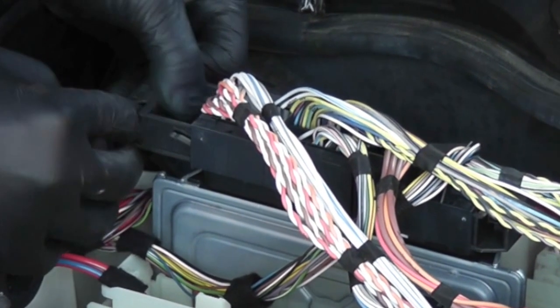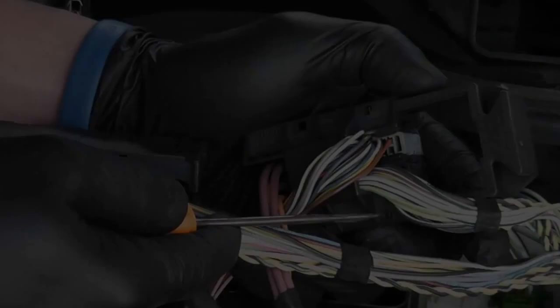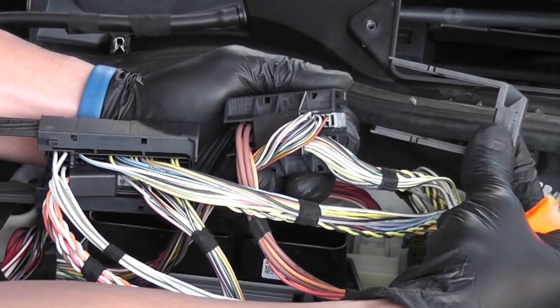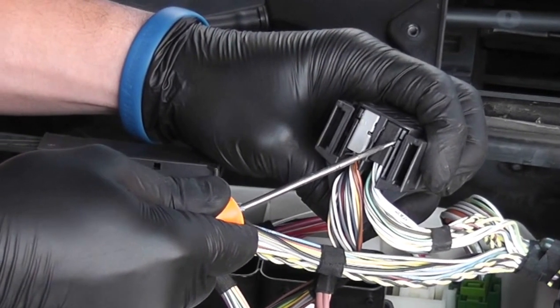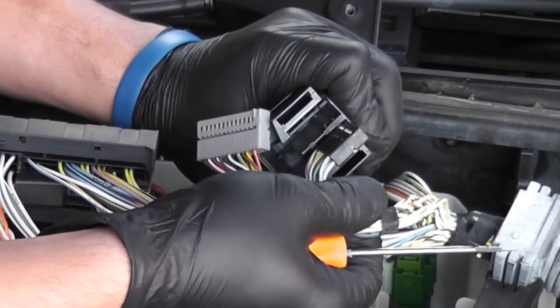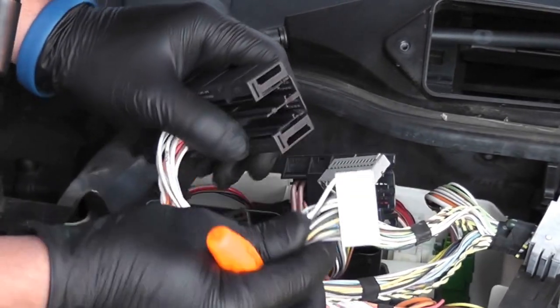Pull to the left of the ECU to unlock the first harness. Pull to the right of the other harness to remove. Use a tiny screwdriver to press on both release tabs and pull slightly on the slider. Repeat this step on the other harness as well. Use a tiny screwdriver to pull back on the tabs which hold these sub-connectors secure. With the tabs pulled back, slide the sub-connectors out. You will need to repeat this process with the three remaining sub-connectors.